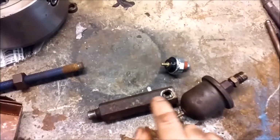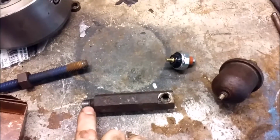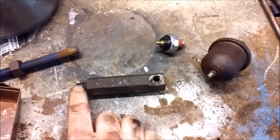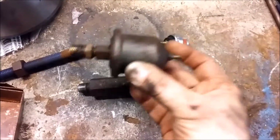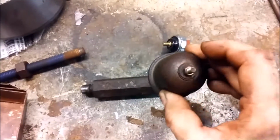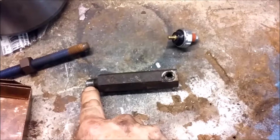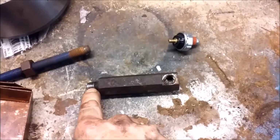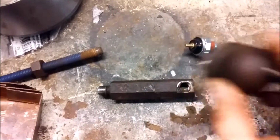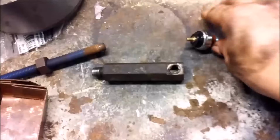This is an oil pressure extension on Fords. The tap in the block is just quarter NPT, but it's up inside a little area on the block where you can't fit this big old chunky sender for the oil pressure gauge. So you get this thing here. It's just a piece of 7/8 hex with the quarter male on this end and a quarter female. This guy screws in here and faces sort of down towards the ground on my car.